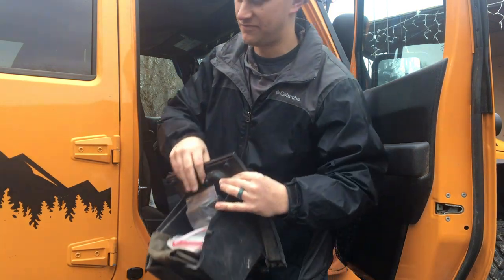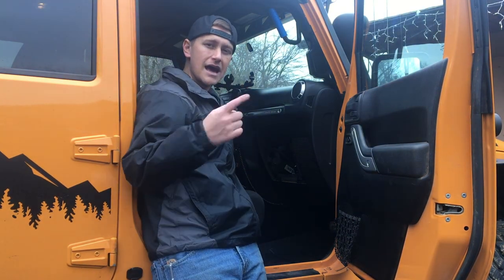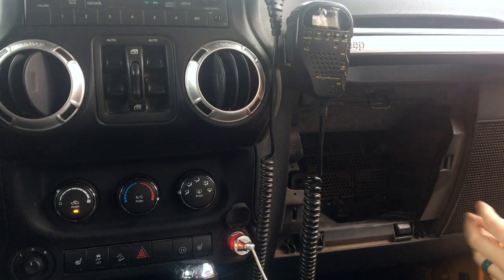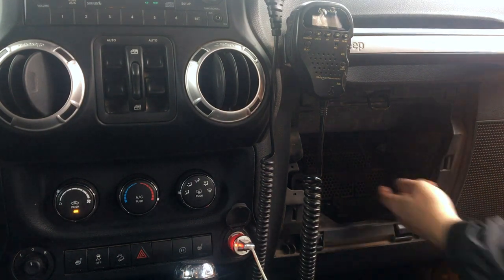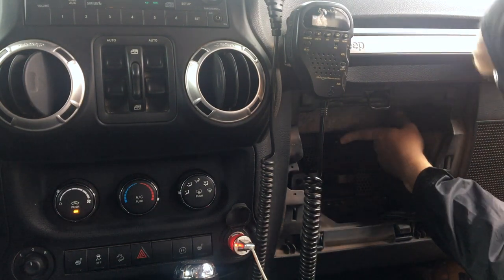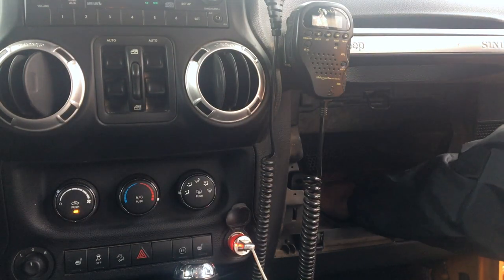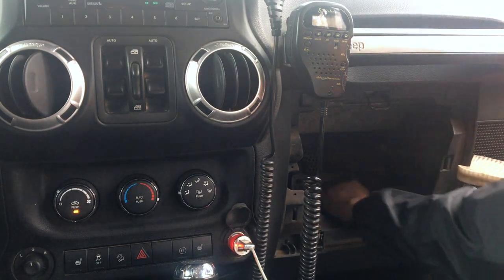First step, remove your glove box. Second step, key in the ignition, turn the AC on, and then hit the cabin air recirculation button, which is the one on the far left. It'll actually open up that little container where the cabin air filters are stored. With the glove box out and that magic little secret trap door open, the next thing you have to do is just open up this little cage right here with a single tab. And there are your two cabin filters. I actually just noticed that one of ours is completely sideways, so that's no good.